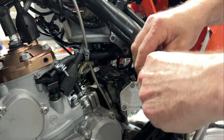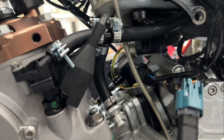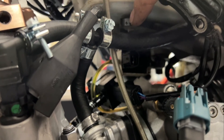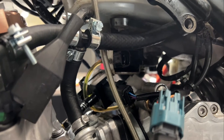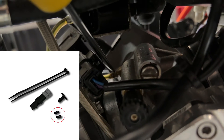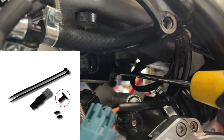Another option is to remove the pump itself. That involves removing the pump from the tray and then using some of the various blanking plugs supplied to block off the barbed fitting into the throttle body, which is down over here. That barbed fitting can be blocked off using one of the rubber plugs supplied in the kit. Also, if you look up behind the oil pump there's a rubber elbow piece which feeds oil into the pump from the main oil tank — if you remove the pump, we supply a blank which can go into this rubber elbow fitting to block it off.